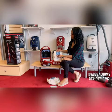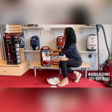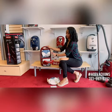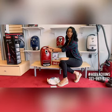Take your bag — you'll notice two little arrows on the top. Match those little arrows up on your machine, pop that little tab in just like that. Then tuck your bag in and close it up. And there you go — you have changed your pre-filter, your HEPA filter, and your bag in your Miele.